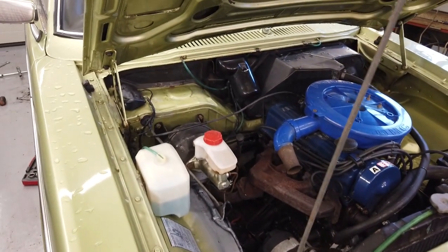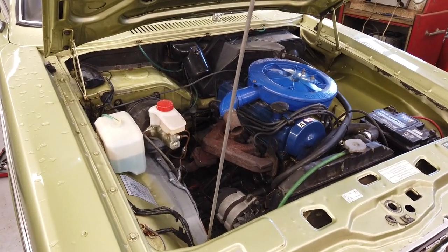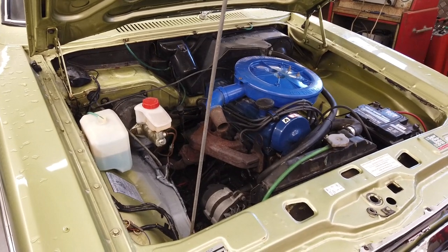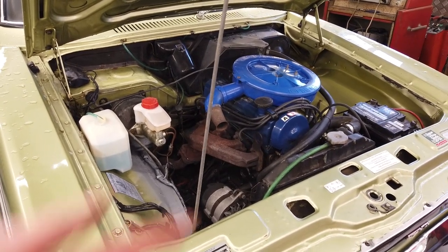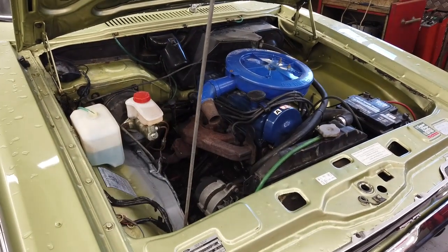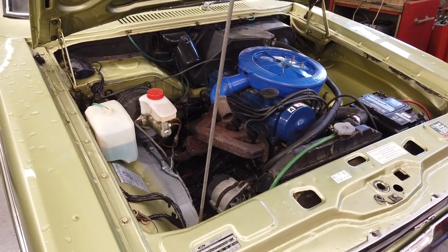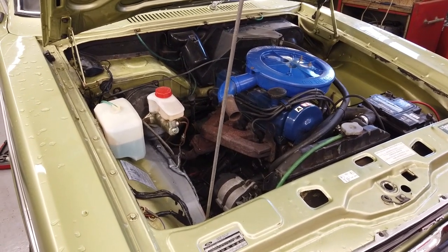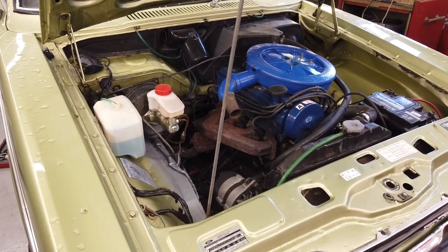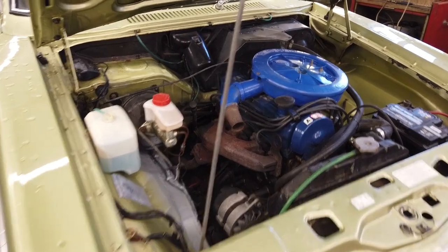I think the wax oiling that I did in the 90s has helped, because I think we put about 5 litres in this. I've got a photograph of me somewhere just gunning it in with a red hot heater, and it really did pour in. And it was wax oil, which I now replace with Dinitrol or Bilt Hamber rather than wax oil. I think Dinitrol is better stuff. So you learn as you go along.